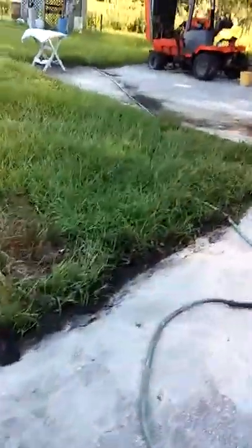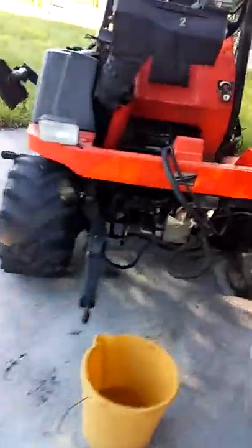That's got a universal going on it right there, you can see it — it just sheared it. And that bearing on that pinion right there is gone. That little clanking I'm hearing over there is probably this little bad boy right here. That's what was wrong with the other one. Luckily, I got a spare over here. You can wiggle that pinion bearing around — that one's okay. That pinion bearing is okay, so that's good.